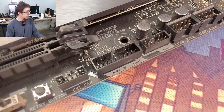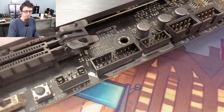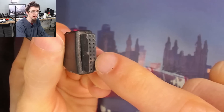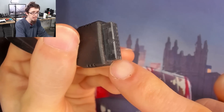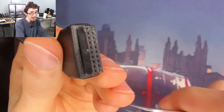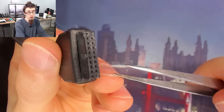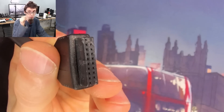That is repaired - the motherboard is done. Now we need to get the old pin out of the header wire from the case. This is going to be a little bit trickier. Here's our header plug - you can see it's all a little bit dented and mauled from attempts to plug in. This is a terrible connector, so that doesn't surprise me. We've got to get that pin out, but it's flush buried in there - there's no room to get tweezers onto it. Even super fine tweezers won't have the strength to pull on it. So that's not going to work.